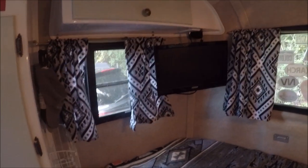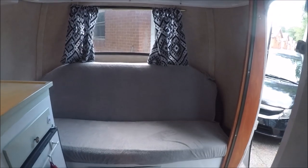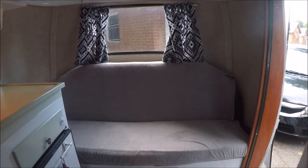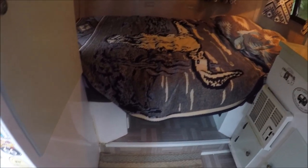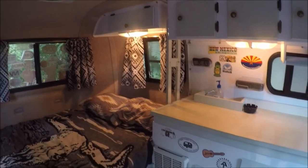Over in the corner I've got a TV that's also a DVD player — really nice on a rainy day. On the other side I have a top cabinet above the sofa and a light above it. This area is my sofa but it converts into a bunk bed. I changed out the floor because the original wasn't to my liking and trimmed it with quarter-round which made it look a lot better. I also painted the cabinets — sanded them with 220 sandpaper, put a coat of primer, then enamel paint, and a coat of lacquer on top.